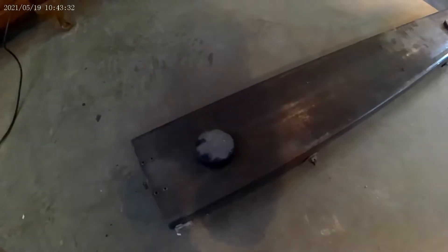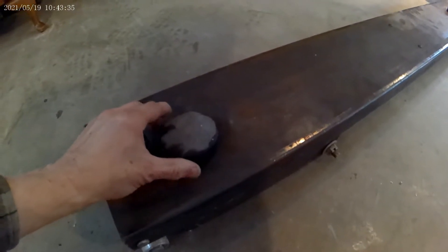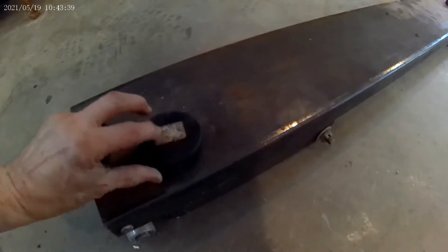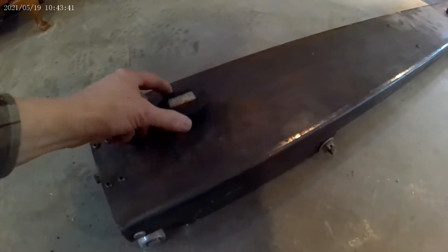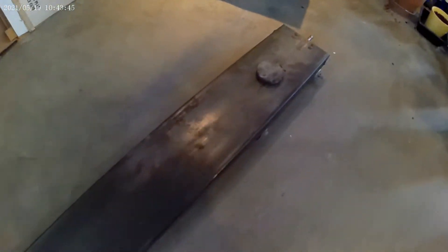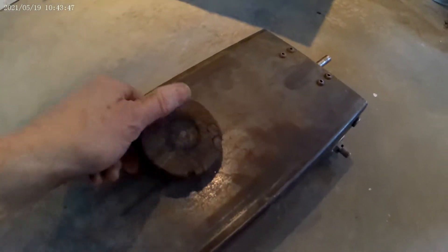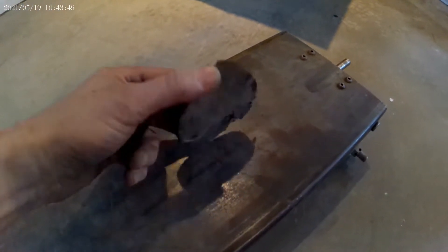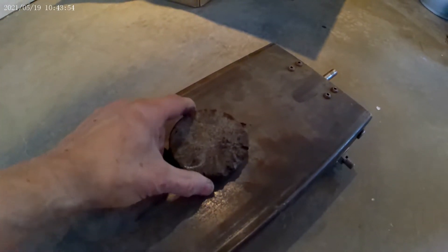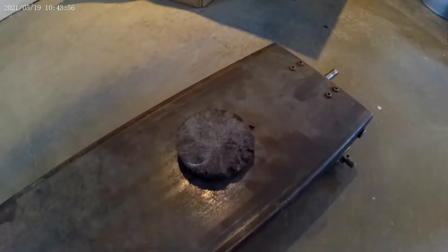To protect the frame of the car I'm using hockey pucks. Hockey pucks are really nice — they're super hard rubber and really inexpensive. This one is brand new, probably paid a buck or two. Here's one I've used for years — probably ten years with my hydraulic jack — and after ten years of work it's hardly worn at all, well it is worn but still quite usable.